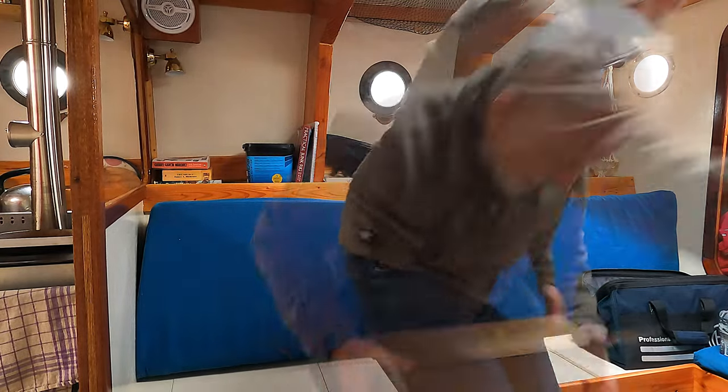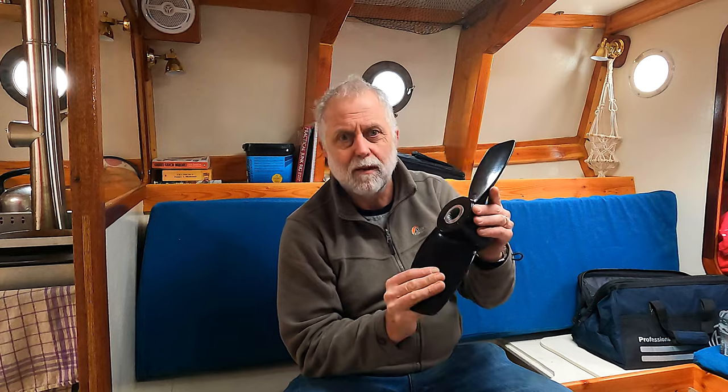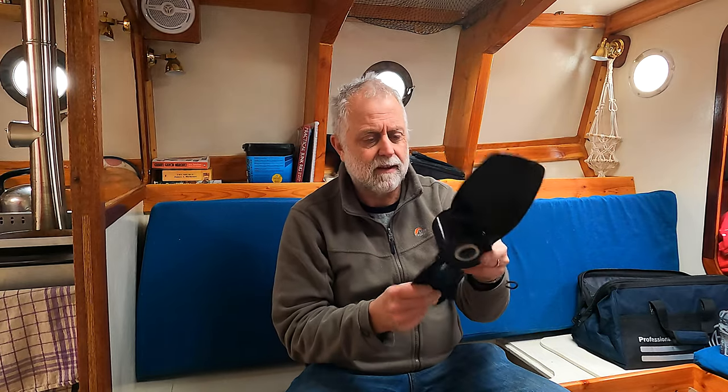I've also purchased a very beautiful larger propeller — look at the size of that beast! It's a 16 by 9 — 16-inch diameter, 9 pitch — which is significantly bigger than the one I have. It was recommended to me by the lovely Frau Kirschbaum at the Austrian propeller selling shop. I should get a bit more thrust out of that without overpowering the engine. Certainly looks bigger — it's very nice.